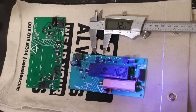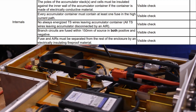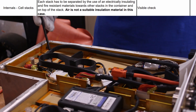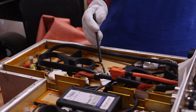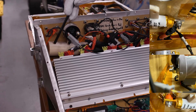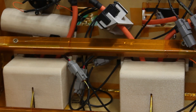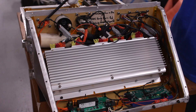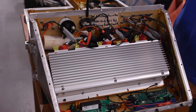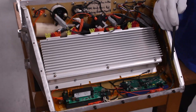We also have included a board without conformal coating as reference. Moving on to the internals of the accumulator, every conductive surface is either covered by Kapton or Kevlar, as seen here. We can see our main high-voltage fuse, which is housed behind this cover, as well as our contactors, which are behind the BMS. We also have our only Tractive System lines leaving, which are for our pre-charge discharge and our main high current path, both of which are not always energized.